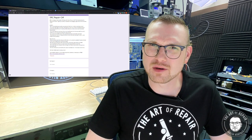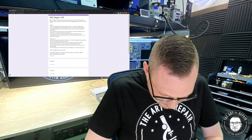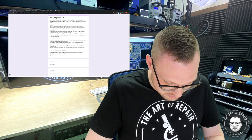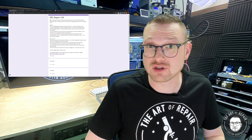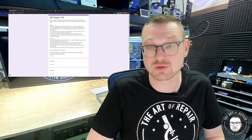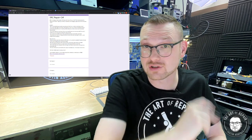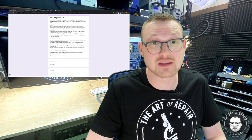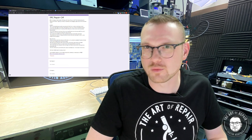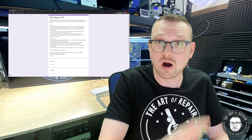What kind of phone and what kind of repair are we going to be doing? We were thinking about what everybody's going to hopefully have in their shop that won't be too high-end to push people out. You don't have to worry about micro soldering — we're not doing that, just level two stuff. You are going to need an iPhone 7 that has good glue on the screen. The device needs to turn on, it needs to charge, and the bottom microphone ports need to work — which is your next clue. We are going to be doing the lightning dock flex cable on an iPhone 7.